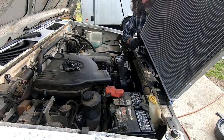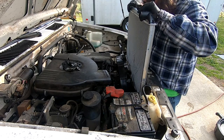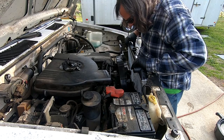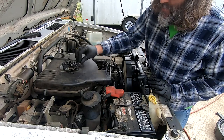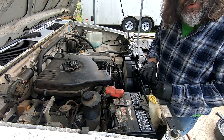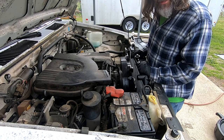I'm going to make sure the drain is tight so that when I start dumping fluid in it won't run back out. Then I'm going to be real careful sticking it down in there. Let's take the little rubber pieces and push them back down to the top, then this piece of metal goes in from the front because the bolt goes in from the back. Then we're going to go back under and hook up the bottom radiator hose and both transmission lines.